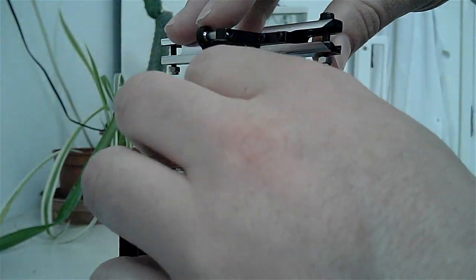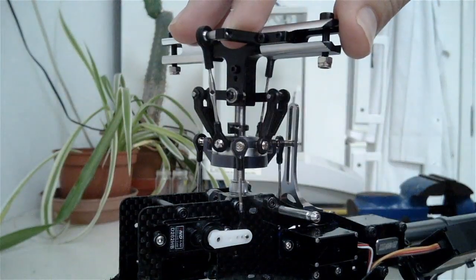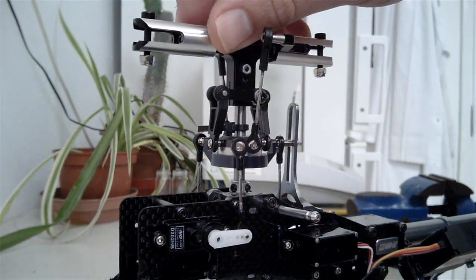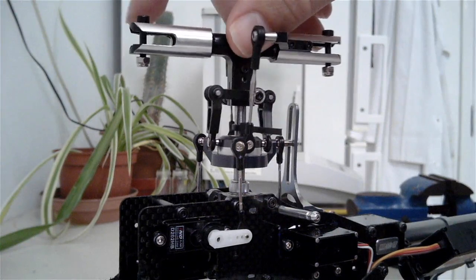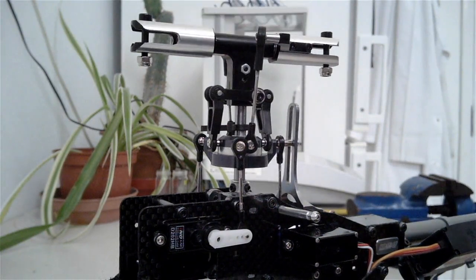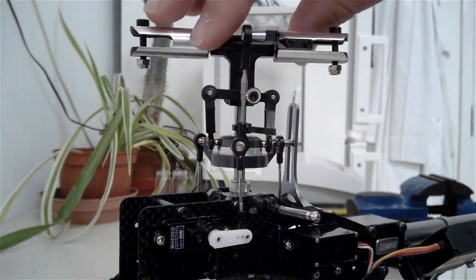Okay, let's just bend our cable tie down so it's almost touching. Right, it's almost touching. Let it go past the rear one. That's a lot closer. And that one, it's quite a way off. And you carry on like that. You shorten whichever one the cable tie is closest to make it more like the others, and eventually you'll get them all the same.